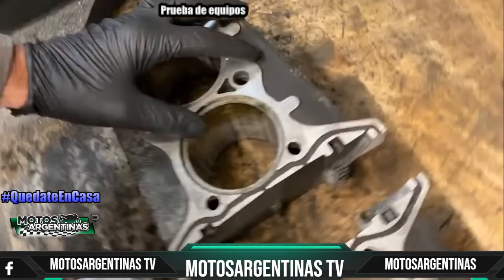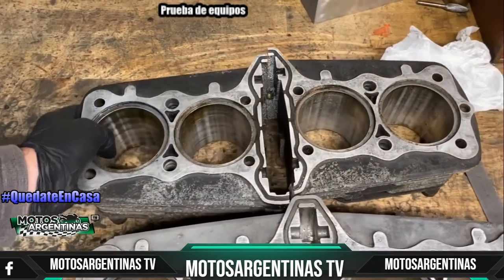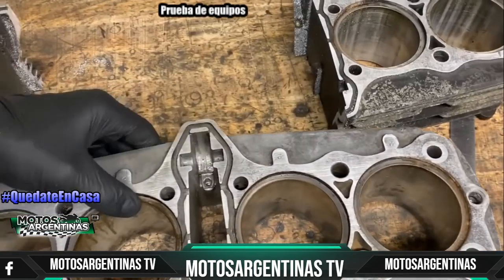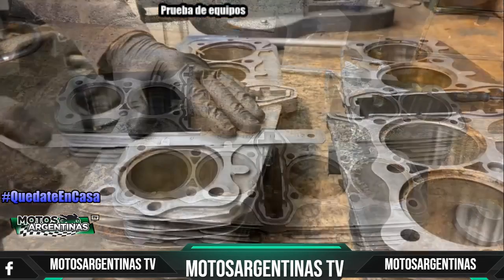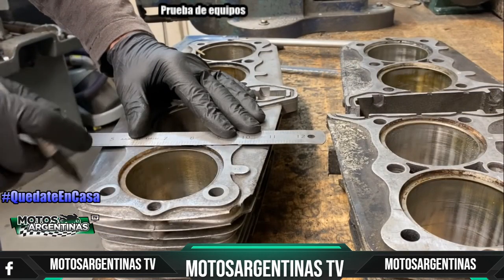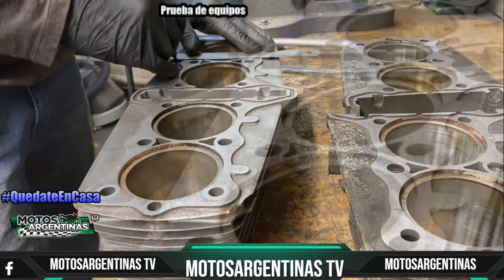With the first set of barrels cut in half, I place them on the bench and slide them up behind the other set of barrels so you can see how they're going to form when they're joined together. The rear is the outer and the front will be the middle. So before I start cutting the front, I scribe 2 nice lines and then I'm going to go out to my bandsaw because it's so much easier than using the hacksaw.